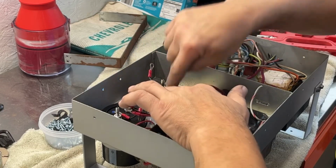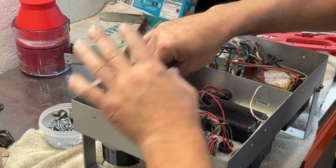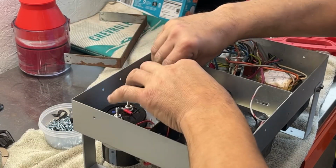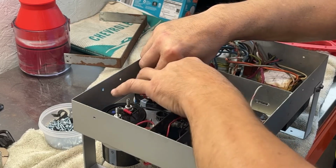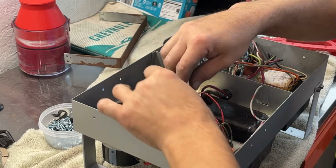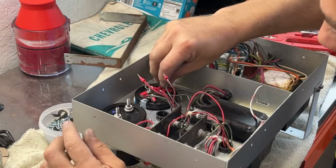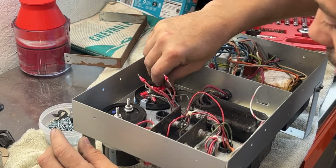So the stripes go on the negative side. I was looking at the picture right, but I forgot that these capacitors I had spun around. So that's something you definitely want to make sure you check before you just go sticking them on there and you screw up and put them on the wrong direction, because that would suck.